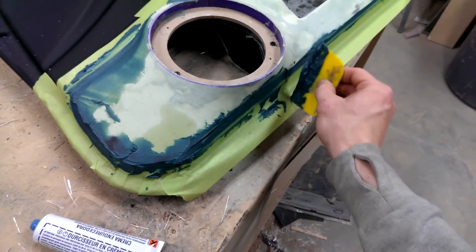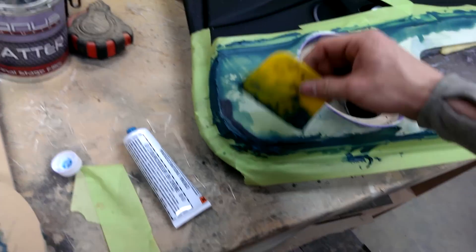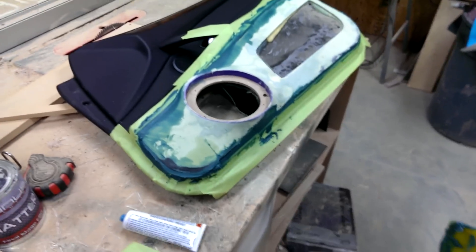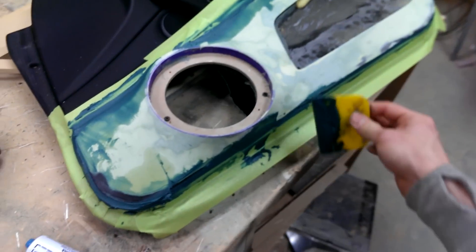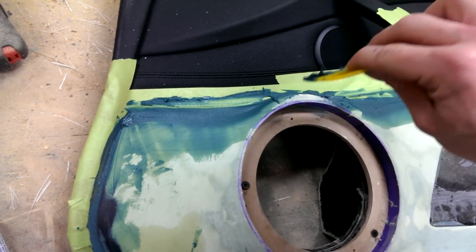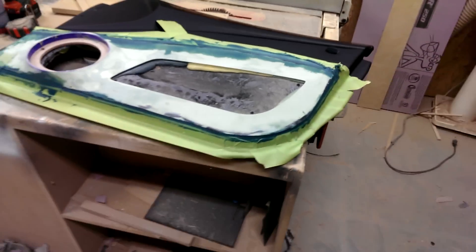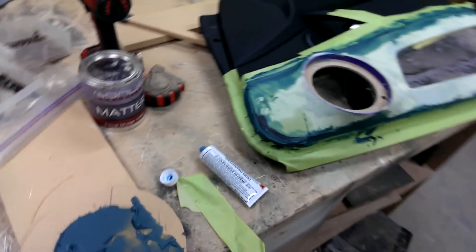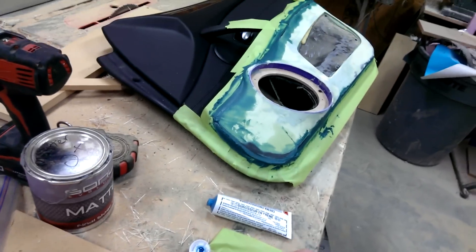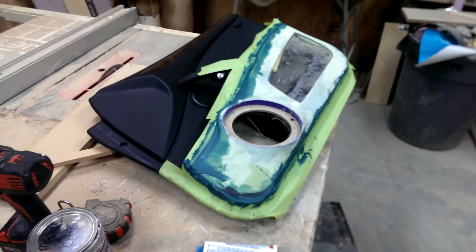Scrape some of the excess off here. I always try to scrape all the excess off the top, but I'll leave a little bit more hanging off on the edges because I don't usually hand sand this — I'll sand it with a palm sander or a DA, and I'll also hit it with a cheese grater type thing first before I even take it off the panel, to get all the high spots off when it's still kind of tacky. That'll save you a ton of time in the end. Once this dries you can sand it down — most of the time you won't really need to do any finishing work, but you can always add some lightweight filler to fill any spots that you missed. But it's pretty much it, I'll have some pictures up.